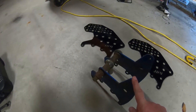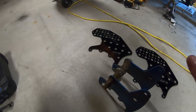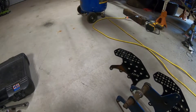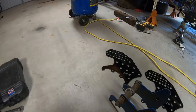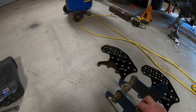These are brackets that go on top of the quick change rear end, and the pull bar mounts to those. The other end of the pull bar mounts to the chassis, and that pulls and pushes — it's really a push-pull bar, I'm told, just learning about this stuff. As the rear end rotates forward and backwards, that bar helps you get traction.